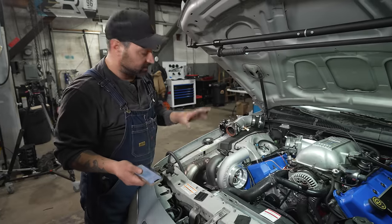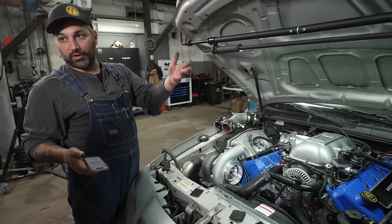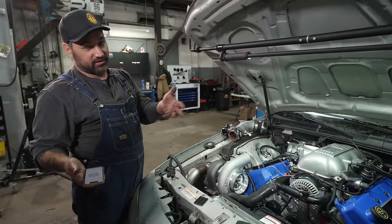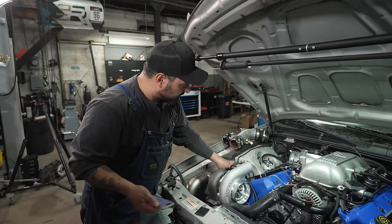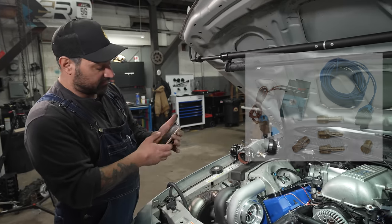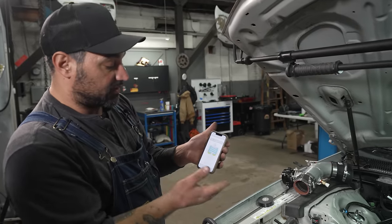So we are dialing in our boost controller on the Cyclone. We just run a ball and spring. We haven't anything really sophisticated. This is a much more sophisticated system, and you need a Holley Terminator, or a dedicated boost controller computer to control it. And there's going to be a three-prong solenoid like this. One is the vent, one goes to the top of the wastegate, and one goes to the bottom of the wastegate. Now, if you go on Holley's site, there's a great diagram of how a wastegate works.